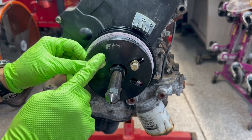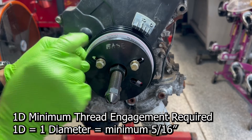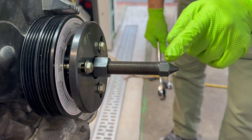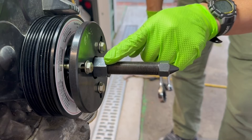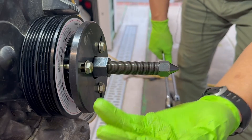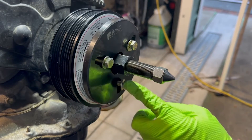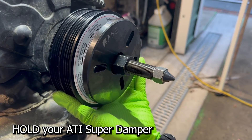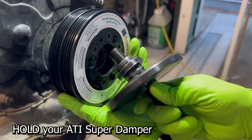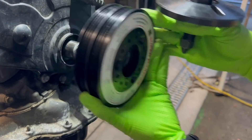Not only do the 5/16 inch bolts have to be installed the same depth, but also their thread engagement must be at least 1D — meaning they require at least one diameter or 5/16 inch of thread engagement. Similar to installation, we're going to hold the center shaft with a 19mm socket and breaker bar, and then use a 27mm wrench and rotate the drive nut counter-clockwise. This will pull the ATI Super Damper off concentrically and will not damage the crank snout or the ATI Super Damper. Remove the base plate first by removing the 5/16 inch bolts. Hold the ATI Super Damper and loosen the center shaft with a 19mm. Once loose, back out the center shaft by hand. If the center shaft comes out without the crankshaft adapter, no problem — use a 22mm to pull it off.